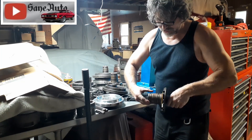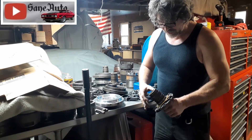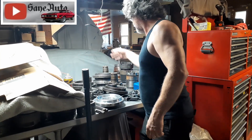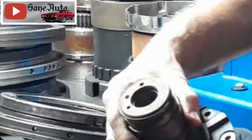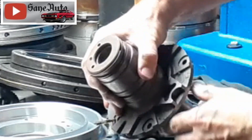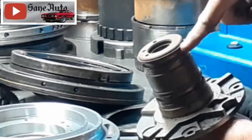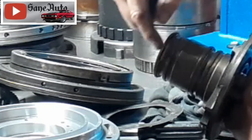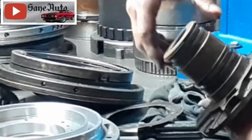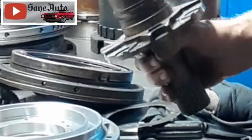Another thing to look for on these stators: do the old rings still turn fairly well? Right there you can see that one's kind of stuck — there's a little bit of dirt right there. That one must have been dropped on the ground and pinched right there. I'll show you a more severe one — this one right here, I marked it a while back because there's a slight crack right here where it had been thrown in with some other parts and another part hit it right on the edge.